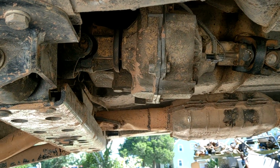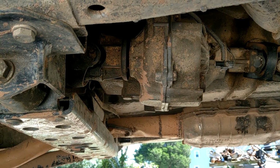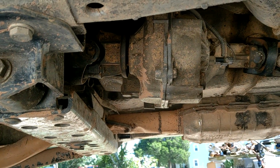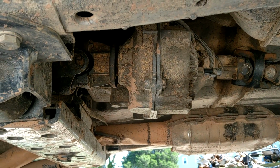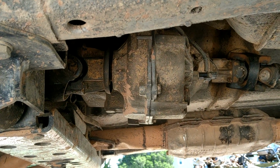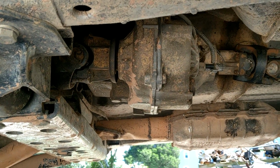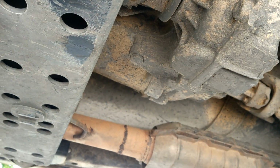And while we're in there, if you've ever heard about the planetary upgrade, the Jeeps only have a 3 planetary 4-low thinger, which makes the gear ratio reduction. There were some Chevys with 4 pinion, and some, I think, higher end Dodges with 6. That might be a 241 case. I'm not totally sure. You'll see all that later. But we're going to tear this thing apart, and we're going to put some big stuff in there. Simple, eh? Enough talking. So, how do we get the damn thing out of here?